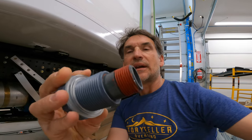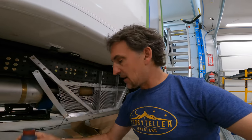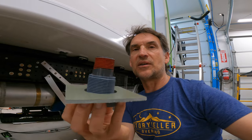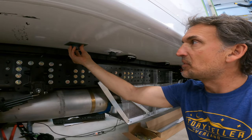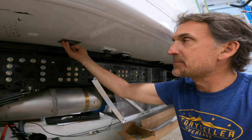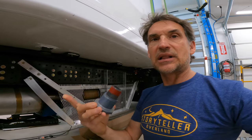What I'm using here is essentially a bulkhead fitting — a through-hole fitting — with a two-inch nipple on the end. This bulkhead fitting has a silicone gasket and a one-inch threaded MPT connection. On the bottom I'll have a one-inch on top interconnecting with a nipple through the pass-through. I've already cut out a fiberglass support to spread the load and seal. I'm going to glue this onto the floor at the bottom of the camper through the hole I've already drilled, and I can still remove this should I ever need to fix the plumbing fittings — but now I've got a straight pipe all the way through.